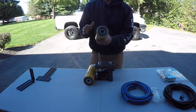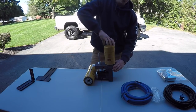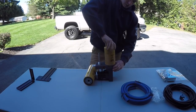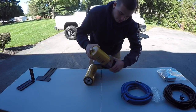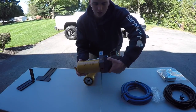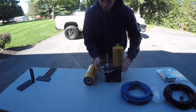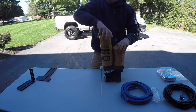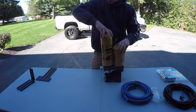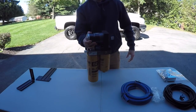We're going to take our gasket and feed that on top. We're going to take our water separator side — that doesn't get the draw straw because the water will sit at the bottom and you wouldn't want to suck that up. Put that on there. The gasket does seal — it may not look like it, but the gasket gets deeper inside. Then we'll take our particulate filter and slide that on there. And that is one FAST lift pump right there — that looks awesome.